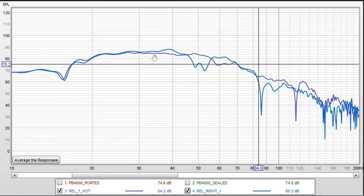I'm comparing measurements of the REL on the left side of my home theater to the REL positioned on the right side. The PB-4000 did not measure as well on the right side of my room, and the same is true for the REL — it's a bit worse on the right. From 35 Hz down, the frequency response is just about the same. The REL on the left stays flat-ish from 35 Hz to 57 Hz, then starts to drop off. The REL on the right has a bad-looking W-shaped drop-off between 45 Hz and 56 Hz and a really bad dip at 86 Hz. So the left side is definitely the best spot.